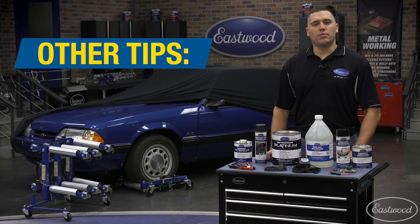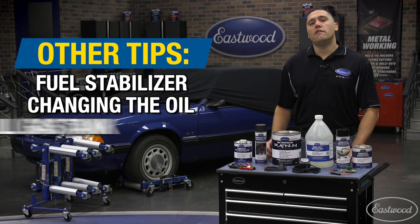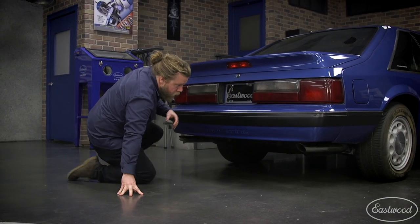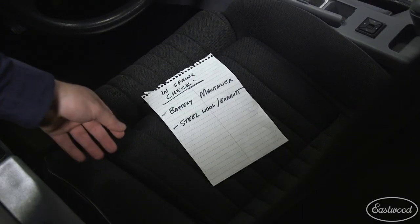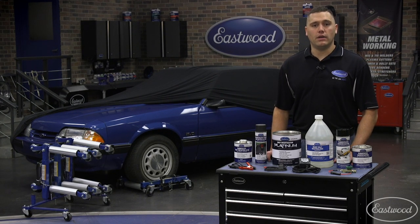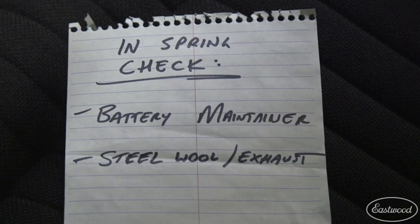Our most important tips outside of the products we sell: use a fuel stabilizer to protect the fuel system during off months to stop gum and varnish buildup. Changing the oil also removes dirty contaminant oil from the system. Filling the gas tank to full will avoid an empty space which can cause condensation. We also like to stuff the exhaust and air intake with rags, steel wool, or a plastic bag to prevent animals from nesting — if using a rag or plastic, it may be beneficial to also add metal screening. Last and most importantly, make a sign and put it on the driver's seat to indicate what has been done to store the vehicle. Imagine accidentally running over a battery maintainer after forgetting it was attached — trust me, it happened, and that's a relatively cheap mistake, but depending on what was done you might cause a lot more damage without a simple list left on the seat.